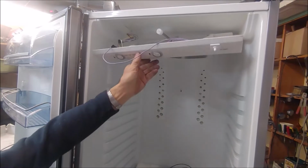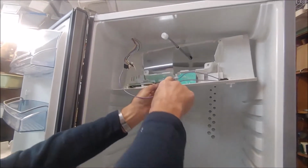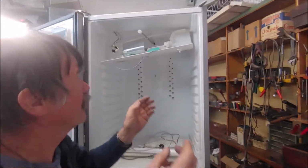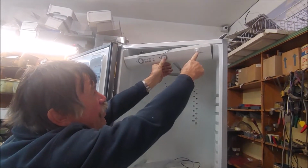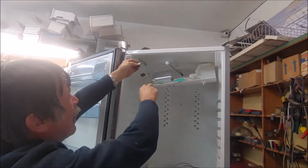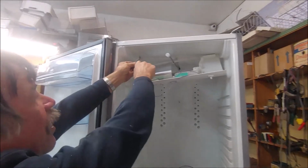So that's easy. The light bulb, which is there, had on the PC board a device called a reed relay. It's a little switch. There's obviously a magnet in the door. When you close it, this activates it. But what I've done is put a little light switch in here, and this is the plug that plugs into the display here. I've cut two of the wires off here.